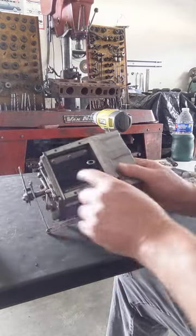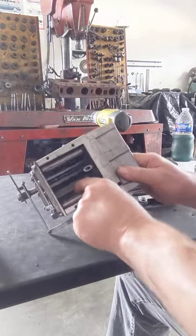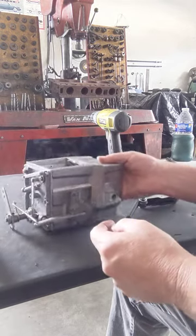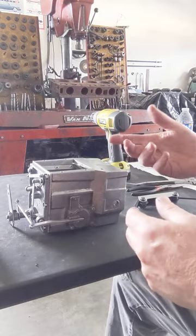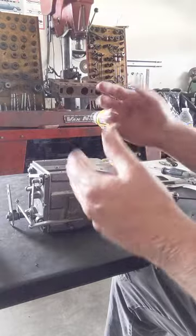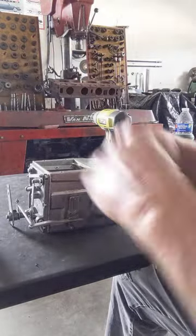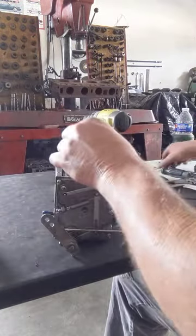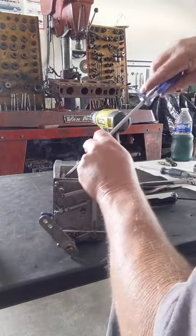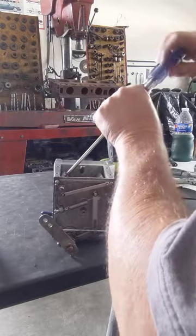All right, now we'll go ahead and take these air doors off. First, you have to take the rubber flaps. These are rubber flaps right here. They're actually backfire flaps. If you backfire in your carburetor, you have to release that pressure, so those things will blow up like this if it backfires. That's a must in anything that can backfire. I'll explain that too.